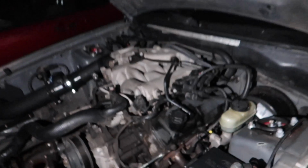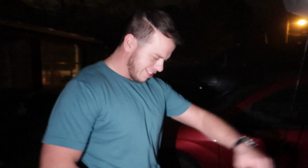Told you it smooths way out. Now it doesn't sound like a tractor anymore. It smooths way out once you get the right coil. Sucker sounds like it has a 350 race cam in there. It's got no O2 sensors in there. Wow, that fixed my problems. I went from being really scared to happy. So that's good. This thing runs now. It no longer has a misfire. I was telling you it had a misfire. You told me it didn't have a misfire. Luckily, we figured that out. Of course it has a misfire. It's got two misfires. Well, yeah, it's because of V6, dog.